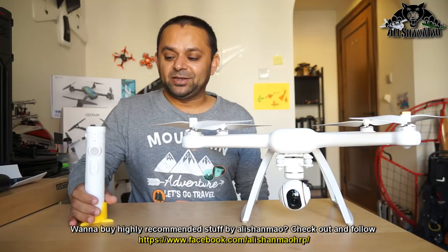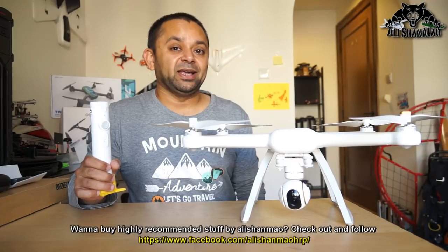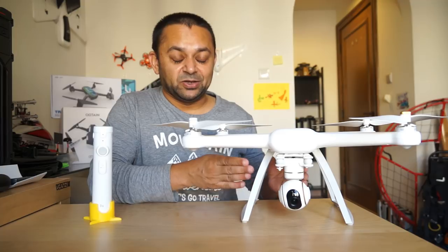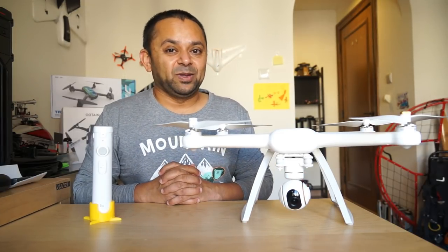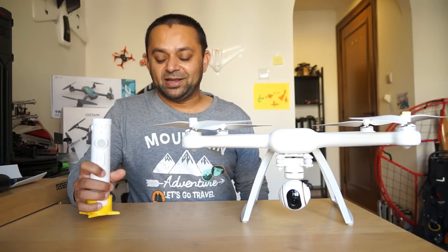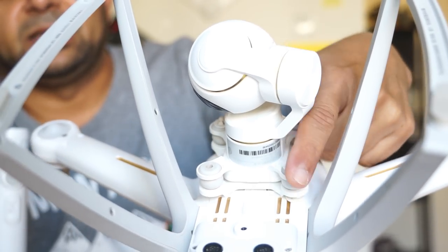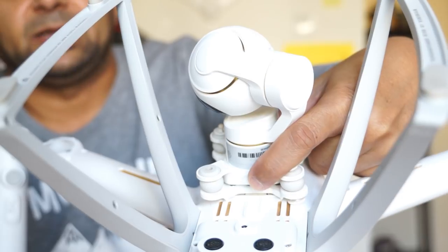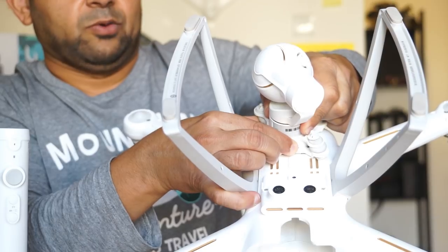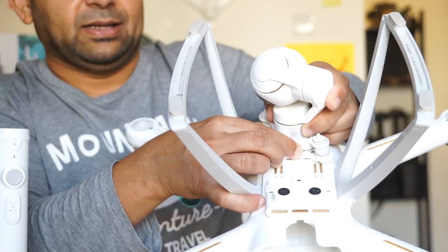And then you can get yourself a gimbal conversion kit for the Xiaomi Mi Drone 4K camera and gimbal and convert this camera system, which is right here onboard, into a stabilized handheld gimbal with this gimbal conversion FIMI handheld stick. So for removing the gimbal and camera only, if you look behind the vibration damping, there's a small white button right here. Press the white button and twist the camera system or its base counterclockwise, and simply remove it.